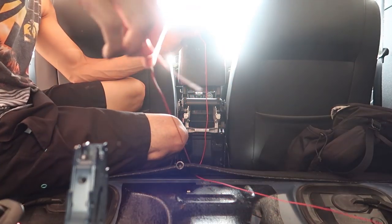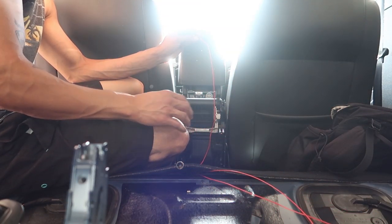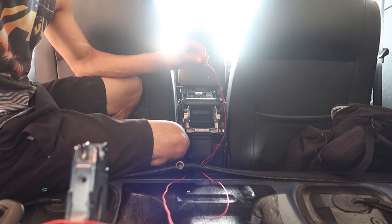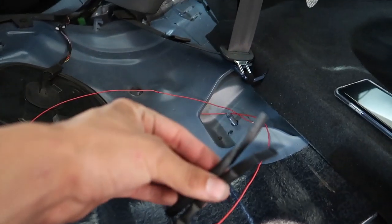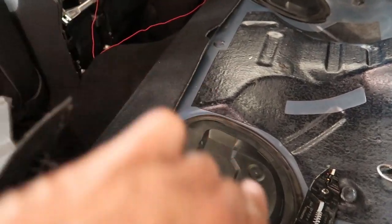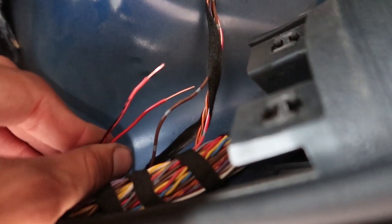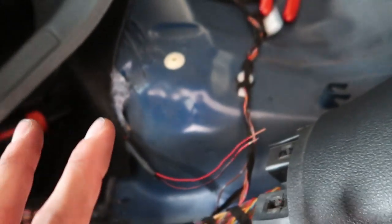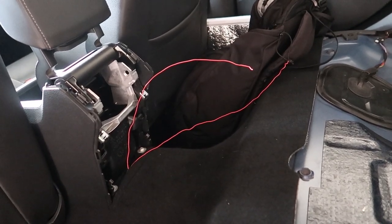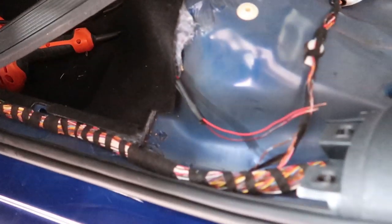I should have done these in different colors so I know which one's which — I feel like an idiot. I'll unwind them and figure it out that way and mark them. Also, don't forget to slip your shrink wrap on before you solder. I took the cables and routed them across here and brought them down — I popped out this little rivet, easy guy to pop out. This is the brown and blue wire — we're going to snip it, wire it in real nice, get some solder on it, button it all back together, then we'll drill the hole and hook these up to the switch. Pretty easy, maybe cost you 20 bucks to do.